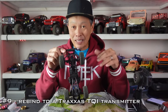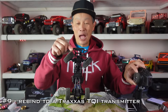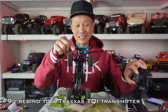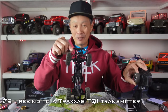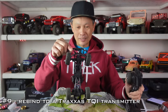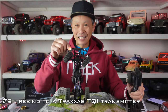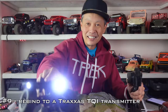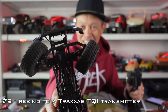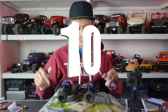I didn't have to limit my end points to something crappy — I was able to set it to 120%. So instead of 45 degrees, I'm now sitting at 50 degrees. I was maxed out, put a little bit of throttle — look at that. You tell me a stock can do that: 50 degrees and super low speed, no binding. That's number nine right there.